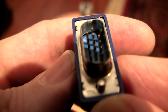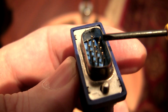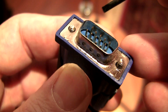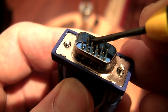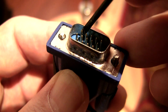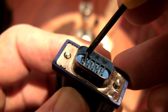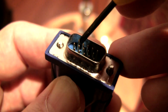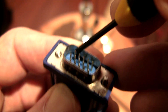So how do I fix it and how do I prevent it from happening in the future? First of all, a precision screwdriver. I look at the pin, lightly put the screwdriver behind it if I can fit it. If I have to get it away from the back, I'll just tweak it a bit, maybe with a smaller screwdriver, and then slowly, very slowly, just wedge the pin back into place. You've got to be careful — you don't want to snap the pin, because then the cable can be useless depending on what signal is coming through it.